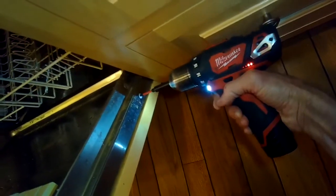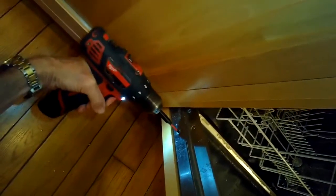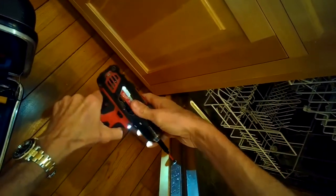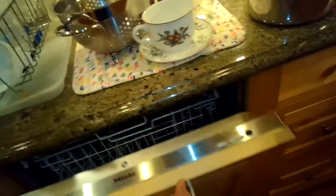I'm going to take off the cabinet cover first by removing or loosening these 4 screws. Actually, we don't remove them, but we're just going to spin them lefty-loosey, and that releases some clips that then will allow me to lift up on the wooden cabinet facade and just pull it off of the door. So this is on the Incognito model and a couple other models. Pretty cool, just blends in with the cabinet. So you grab it, after you loosen it, and lift it up, it'll come right off.